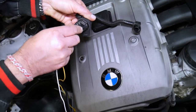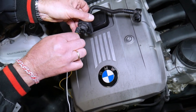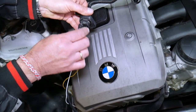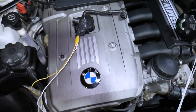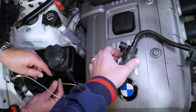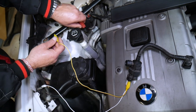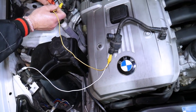We'll share a link in the description if you need to buy a new purge control valve for your BMW 7 Series. When you do not apply 12-volt electricity, the valve should be closed at all times. When you apply a 12-volt supply — I recommend using a car battery rather than the positive terminal directly on the car, as that could damage your vehicle — you will hear the valve open and close.